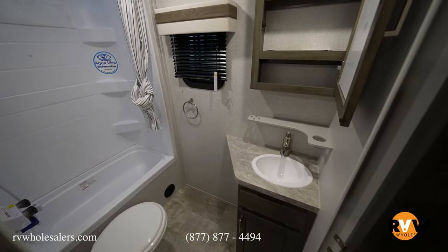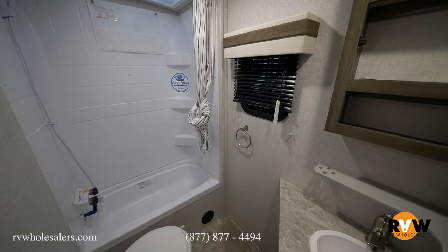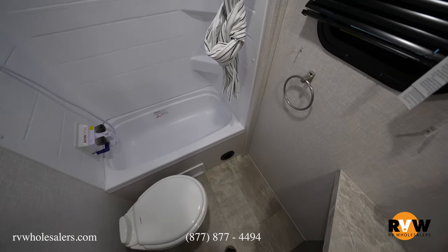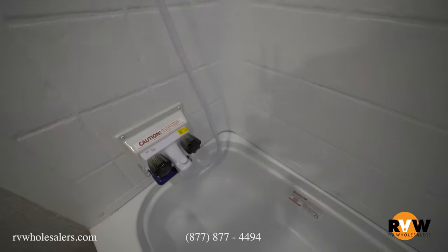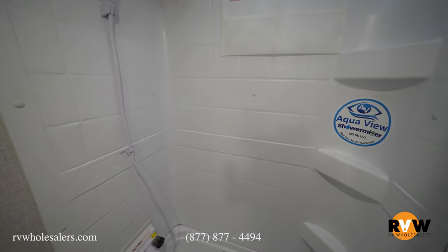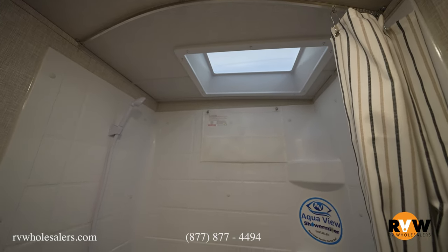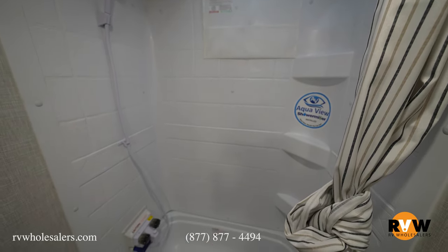Moving into the bathroom, you're going to notice a sink right when you walk in. It does have some nice shelves for toothbrushes and storage up above in your medicine cabinet. Coming down you're going to have your toilet with plenty of leg space, then you move into your shower, which has a nice shower surround. Down below you'll notice this has a shower miser — what a shower miser does is circulate the water and change color so you know when you've got hot water, so you're not running water for five minutes waiting for it to get hot and filling up your holding tanks. It also conserves fresh water. Up top you've got a 10-blade Fantastic Fan, which has a vent cover over the top so if you leave during the day you don't have to worry about rain getting in while your vent is open.